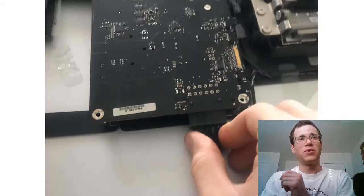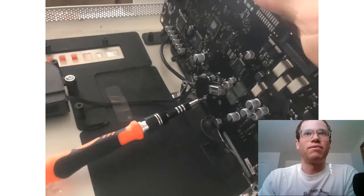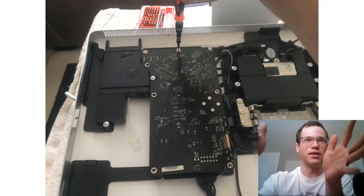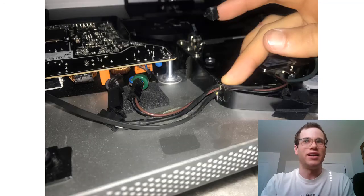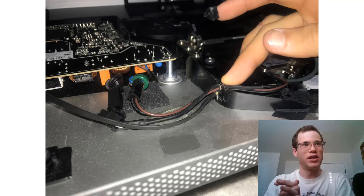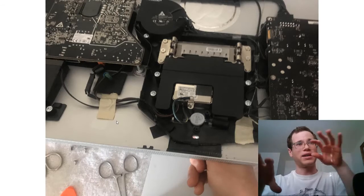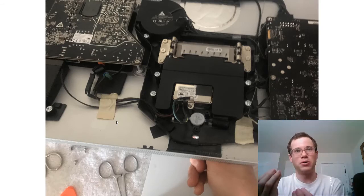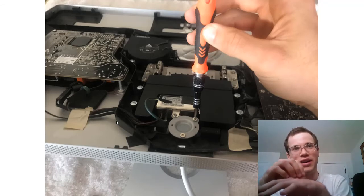Plug the new data cable back in, put the two tabs on, then plug the power cable back into the logic board. Screw down the two T6 screws to push the retainer back onto the cable, then put in the T10 screws to seat the logic board back into the aluminum housing. On the other side with the MagSafe power cable, thread the cable through the plastic shroud inside the machine and connect it back. Use tape to hold everything back down the way Apple had it, reinstall the cable onto the three plastic posts, pull it all the way through, then attach the steel retainer to hold the bracket against the case.